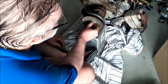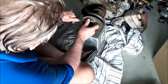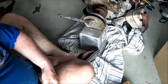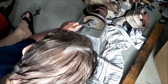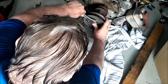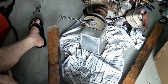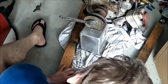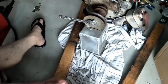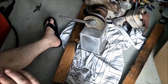Probably gonna have to socket that, I think. Yeah, I'm fine, Smitty. Got a small problem here. Got a small thing to work out. I don't know which way the engine turns, because there's no pull start on it, it's electric start. I may have to look it up. Work out which way it rotates, because one way is going to do it up. I mean, typically bolts do anti-clockwise, but that depends on which way the engine's rotating, if they've got a reverse thread bolt in it.